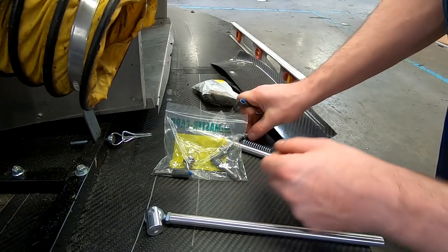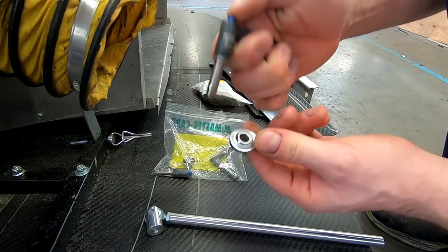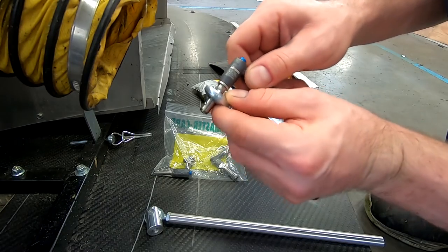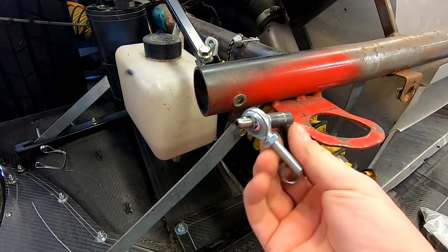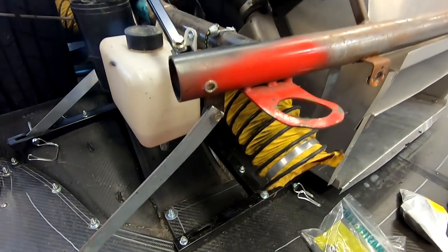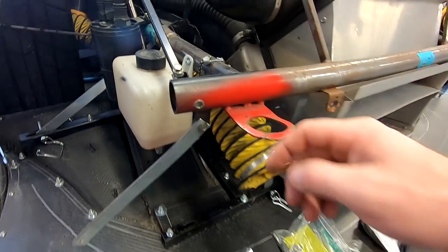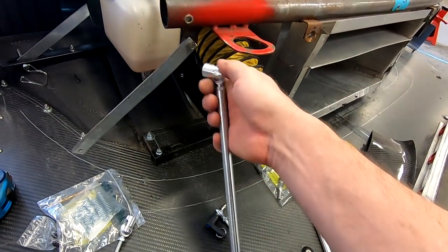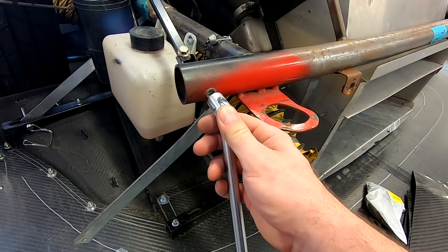These quick pins have a little retainer ball on the end — when you press the button it allows it to slip in and not come out. With this whole setup up here we need it away from the bumper a tiny bit to make room for these quick pin setups. What we're going to do is weld a little tiny extension off of this, longer than we need, then put the bumper on the car and cut it flush so these can attach maybe a half inch to three quarters off the reinforcement beam.